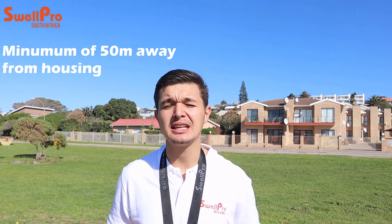We want to explain why the calibration process is so important. Calibration gives your drone the information it needs to understand where it is, how it's behaving, which way it's facing, and where it needs to fly. When performing calibration, be at least 50 meters away from any houses, electrical wires, and phone wires. I recommend calibrating at the beach, away from buildings and cables, and do it where you're going to use the drone.